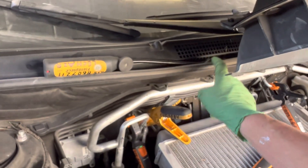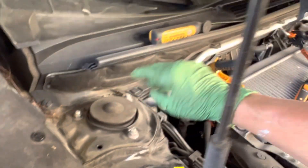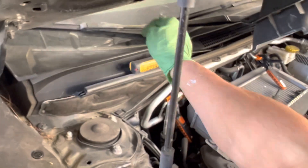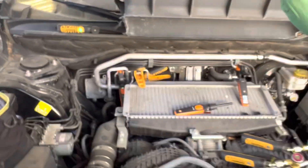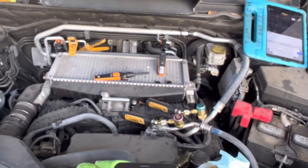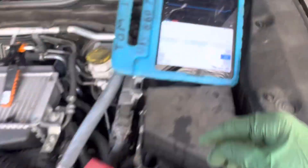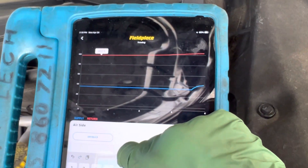This is the air intake. I'm not taking it from the proper place. If I wanted to take it from the proper place, I would take this apart and slip my temperature sensor down in the intake, or I'd take the dash apart and slip my temperature sensor on top of the filter — that's the proper test, because that's not the true temperature going over the evaporator. It's a mix of the cooler 70-degree air plus this 100-and-some-degree air that you see there.